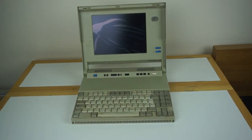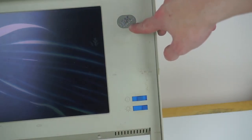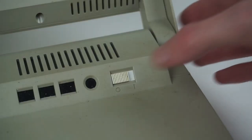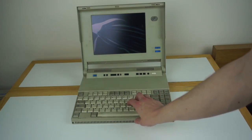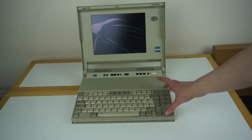So now let's take a look at the machine itself. On the front we see a 9.7 inch monochrome display — obviously broken, but that's what it had. Over here we have the IBM PS2 model designation, and down here we have sliders for brightness and contrast. Down here is a row of indicators — these are interesting because they're sort of LCD panels that are black, and when there's activity the blackness goes away and reveals a symbol, rather than LEDs. Here we have a mechanical power switch, and over here a switch to toggle between auto and manual power saving mode. Then down here we have a large keyboard which is really nice — it's actually nicer than my ThinkPad 755C, very tactile and quite wide with these extra home row keys off to the side.